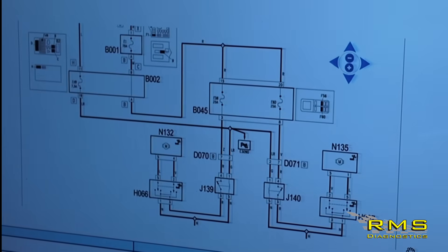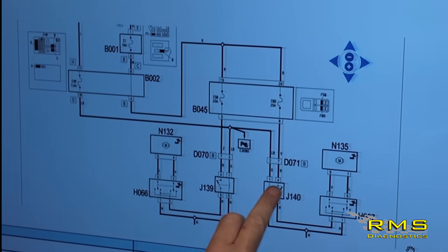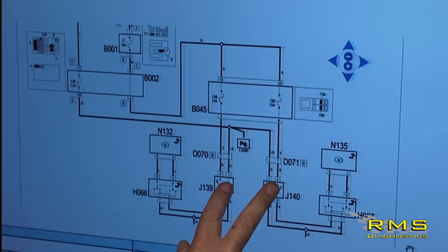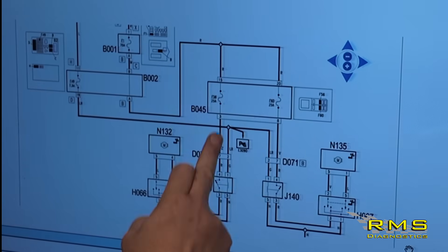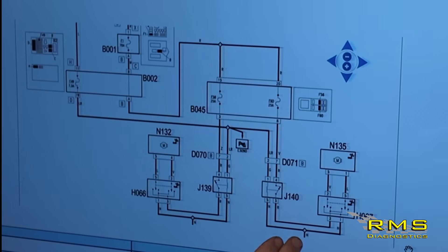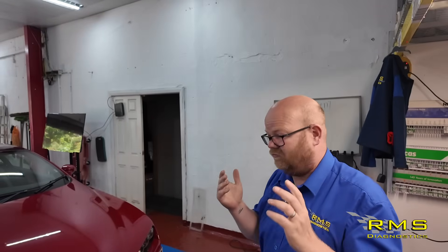We got into the diagrams and had a check through. It's quite a basic circuit - motor on the seat, the switch on the seat, the relay, and two fuses. They've got independent fuses left and right for the seats, but there is a control wire which is linked. So you would think if that fuse had gone it would knock the pair of them out. We went direct to the relay and found that both fuses are okay. We've got main power to the control relay, we've got an earth for the seat and the motor, but the only thing we're missing is the control from this seven and a half amp fuse which also powers the other side - which threw us a tad.